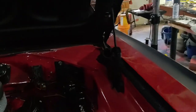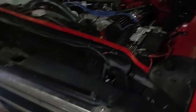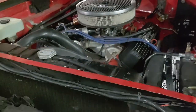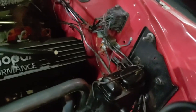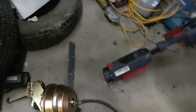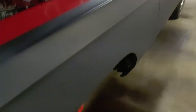Update here on this situation. We got the booster off for the second or so time. We did get it on with all the bracket and stuff but nothing was really working right. It seemed like the master cylinder that came with the kit was leaking down — it just wouldn't bleed all the air out no matter what we did. So we got another master cylinder from O'Reilly's, factory replacement style, didn't like it. Got another master cylinder from online — some kind of high performance deal with much larger reservoirs. We like that one with the disc brakes, but none of these other master cylinders would bolt up to the booster, so the booster is out of the picture.